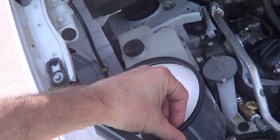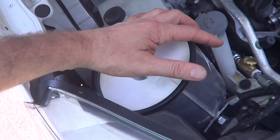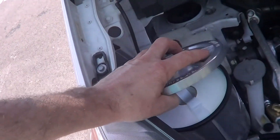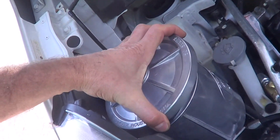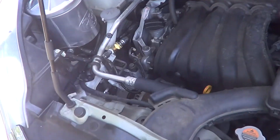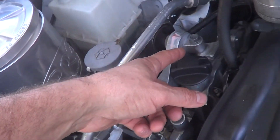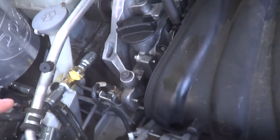I'm going to see if this makes a difference. You really can't get better filtration than this. This engine is too small to drive a centrifugal filter. I have a shutoff valve, and I'm teed in on the oil pump — just like any bypass would do — and then I dump it back into the pan. I have an installation video showing me putting in the AMSOIL bypass, and this is the same setup. I have the valve added for testing purposes to be able to test it on and off.